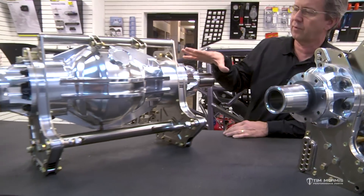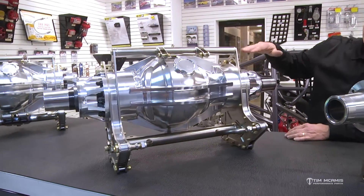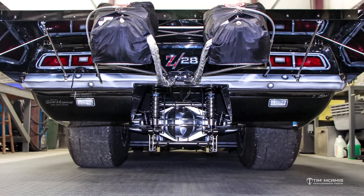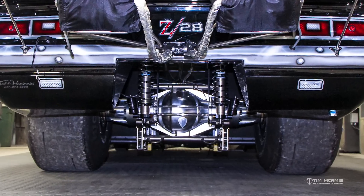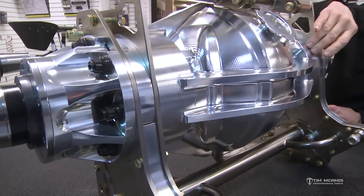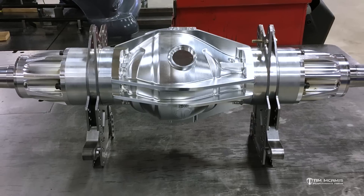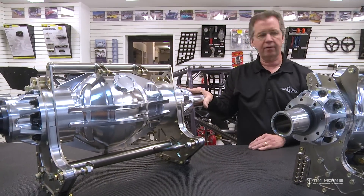This housing here is a standard housing for us, but you'll notice it's a lot wider. We made these center housings where we can get up to a 20-inch center-to-center four-link. A lot of the drag radial cars running now have a 20-inch wide four-link in them, and these housings have been very popular — the Alco C7 has one, Barry Mitchell's car has a billet housing in it. To do that we needed to get the four-link wider, so you can see quite a bit of difference. We can go up to a 20-inch center-to-center four-link, then use a varying length of Mark Williams end bell to get the wheel-to-wheel width that we want.